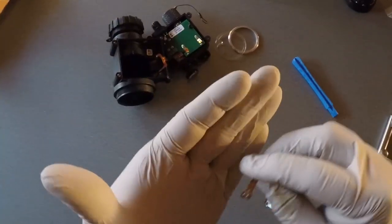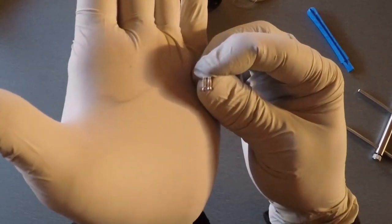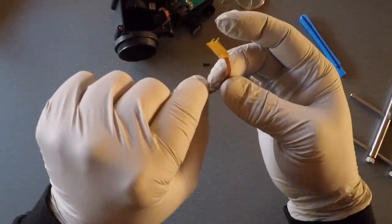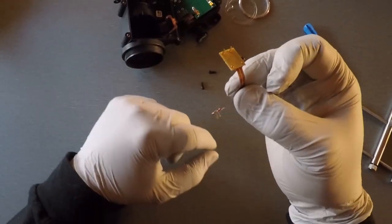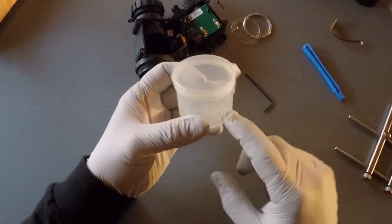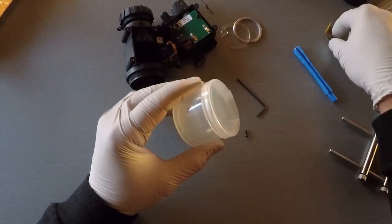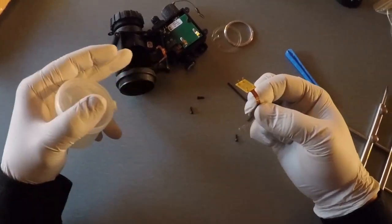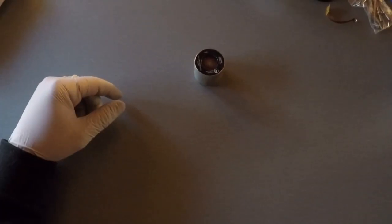You can see it has two little plugs that get inserted inside the tube where they pulled out from, and then there are four pins on the other side that go inside the circuit board on the battery compartment. Put these aside in a safe place. I use a large round container, put them in a baggie inside — that way they won't get crushed, because the last thing you want is to bend or break off a pin if you ever want to reuse this tube in 11769 format.